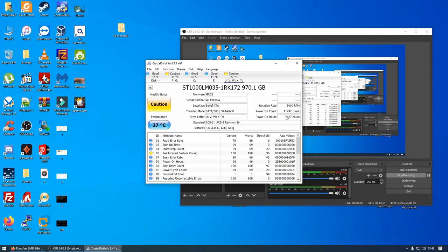The reason for this is because Microsoft decided it would be a good idea to keep the hard drive running all of the time, or most of the time, for faster load up times. But they don't realise that that puts wear onto the console, which is pretty annoying. It kills the drive faster.